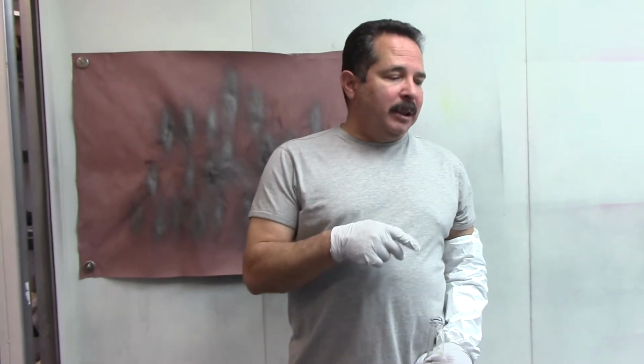You guys that are interested in these guns, you can probably shoot with a 1.3 or a 1.5. Either way, usually I prefer a 1.4, 1.5 on water-based paints. I know Andrew was carrying the Aqualox series 35. It's a good paint. We've used it every day for 10 years. We continue to use it in our line, in our production facility here. So it's good. It's well behaved. It's a real nice paint. Pretty good color palette. Good selection.